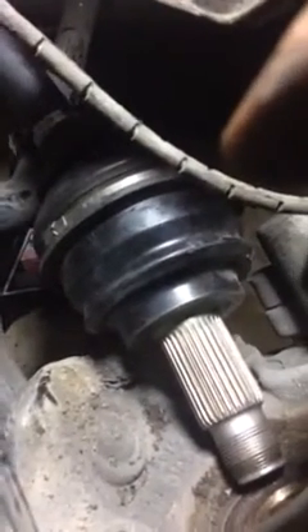Anyway, here's what I did. Once you get that nut off from out here on the hub, take a hammer and just bang on that thing. Watch the other YouTube videos — they show you how to just take all these little strut bolts. I think that's all I did really: strut bolts, obviously the wheel. You can hammer that part out. It will slide out if you hammer from the front.